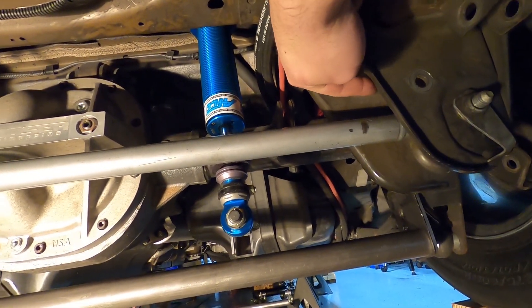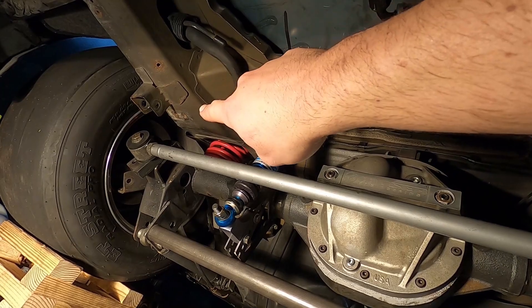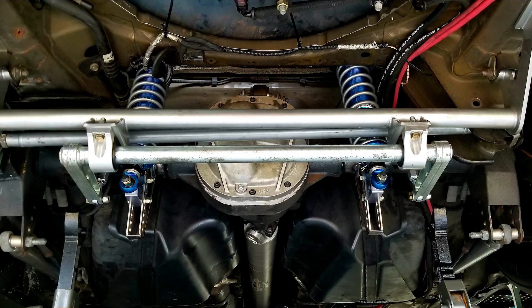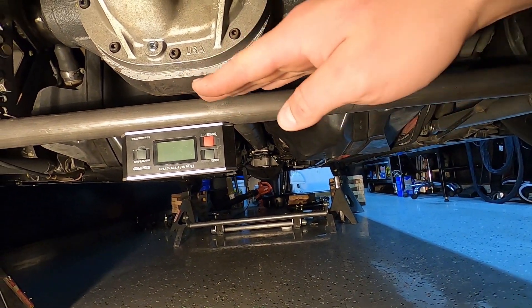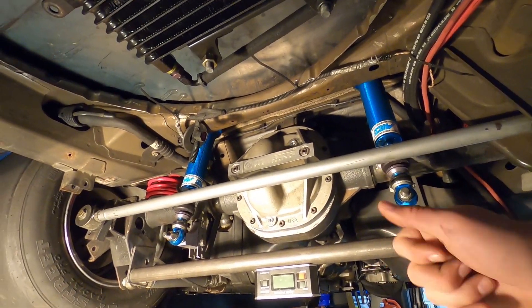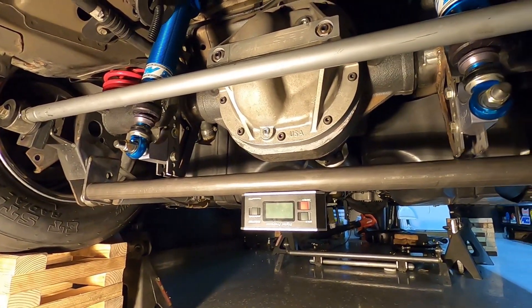The panhard support goes here to those two bolt holes that are just for the anti-roll mount. Basically all of that silver-finished tube in this picture is going to be gone. All we're going to have is this chromoly tube here that the wishbone mounts to. The anti-roll bar is also going to mount on this bar — it'll be on the back side, the arms are going to come out this way, and then it's going to mount somewhere up here. We're going to get rid of all those crazy crossbars.